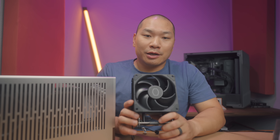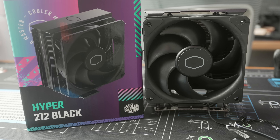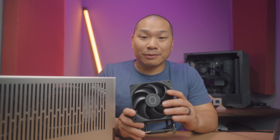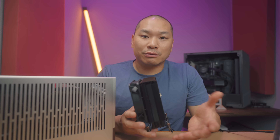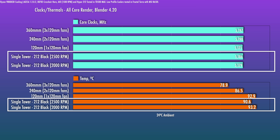If you want to go with less than a dual-tower air cooler, things get interesting. A single 120mm tower — this one is the Cooler Master Hyper 212, relatively affordable and unique in that it has a very high-RPM fan — I'll show results at max 2500 RPM and also at 2000 RPM. It's very loud at 2500 RPM, still pretty loud at 2000 RPM, but otherwise it's fairly representative of a simple single tower. This cooler is one you can just about get by with. Similar to a 120mm AIO, you'll lose a little boost clock, but even at already pretty fast 2000 RPM you are achingly close to throttling. Just like with a 120 AIO, you could get away with it, but you're really not giving the CPU much room for any other factors.